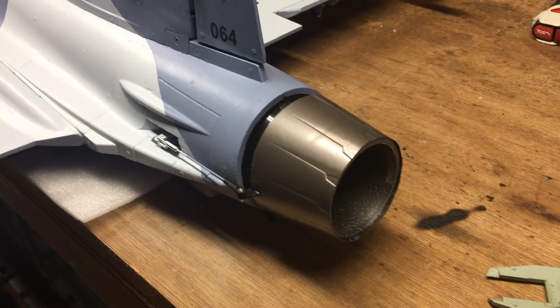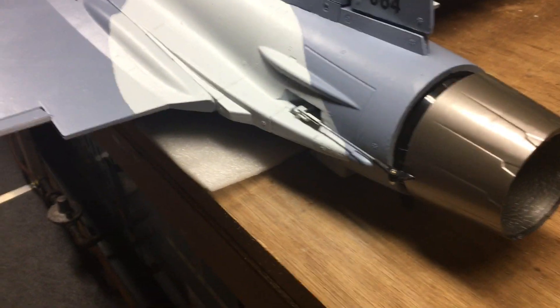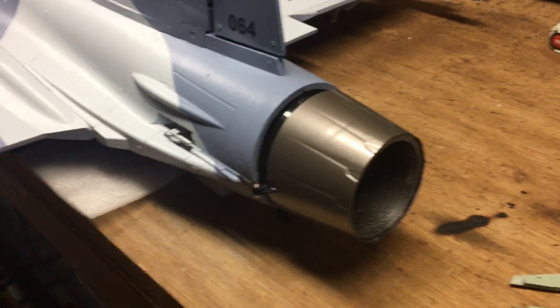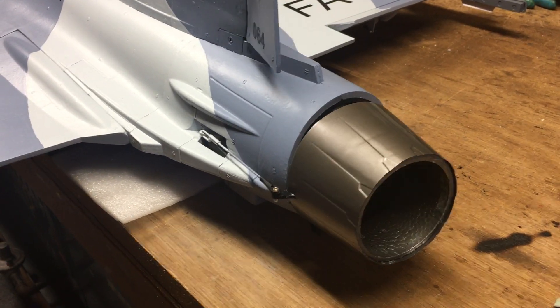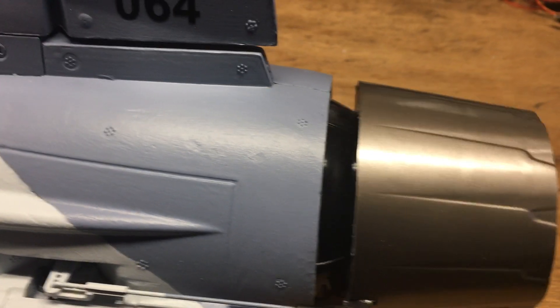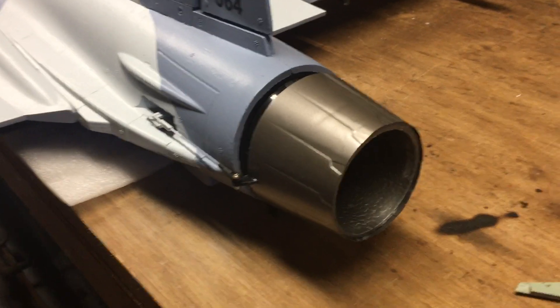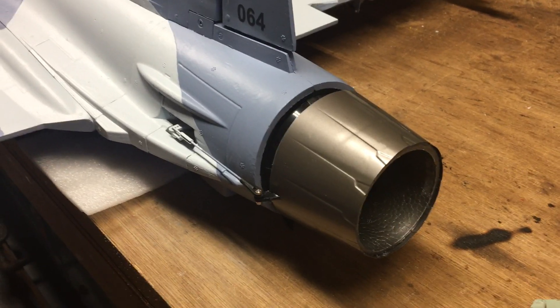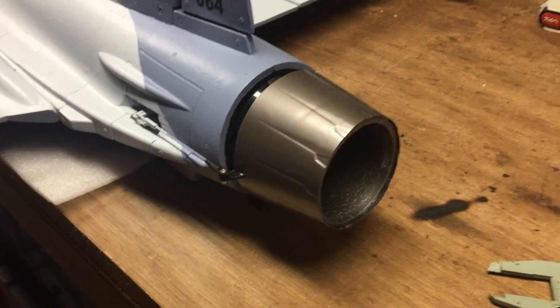As far as my throws, here are the full-rate throws on the thrust vectoring. I've got 18 millimeters of rudder either way, which is not quite full travel. I also have 18 millimeters of pitch, which again is not quite full travel. So that's 18 millimeters left-right of yaw and 18 millimeters of pitch or elevator.